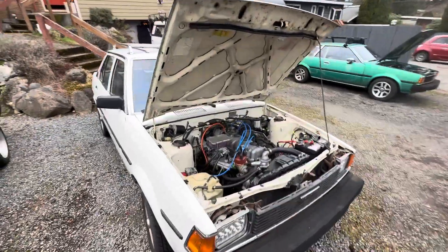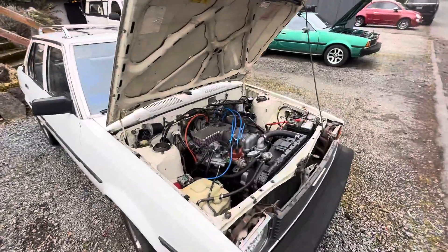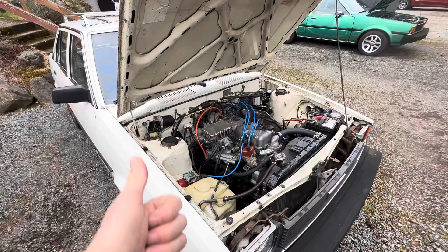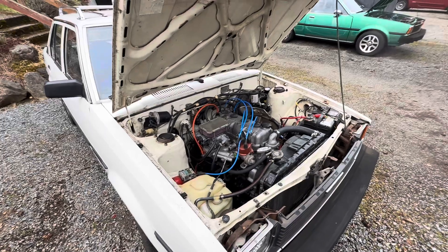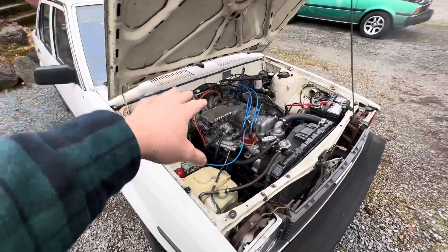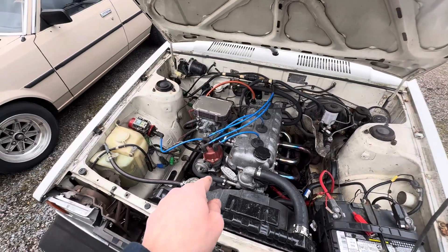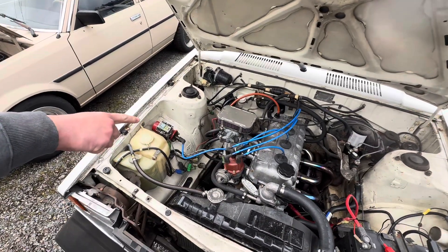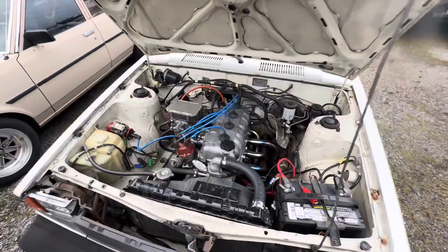Over here is the sedan. For me this is the perfect example of what a Joe Dude trying to do a 3TC on a budget is gonna do. This engine had a quarter million miles. We did a garage rebuild: honed the cylinders, new piston rings, new bearings for the crankshaft and connecting rods. Did a basic at-home port and polish on the head. It's got a Weber 32/36 and a custom ground camshaft — about 232 degrees of duration at 0.050, and 0.405 valve lift. I also opened up the plenum inside the stock intake manifold a little bit, which certainly made a small difference.